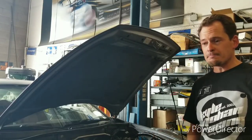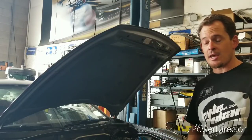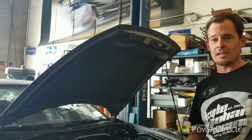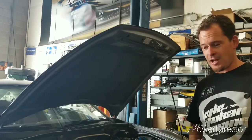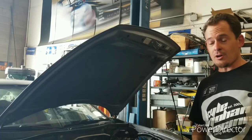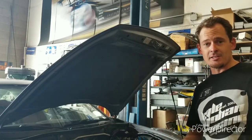When we pulled it apart, it wasn't any of those things. Surprising to us, it was actually a blown water seal, and it didn't even look like it was due to any overheating or anything like that. It really looks like it was a grounding issue, which was kind of a surprise to all of us here at the shop. We expected something else. So that'll be something in the future. We'll check into our car's grounding. But here's a little teardown sequence.